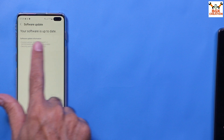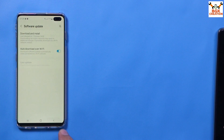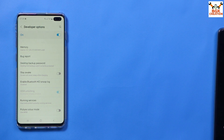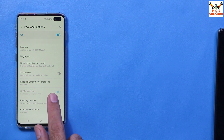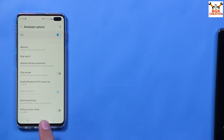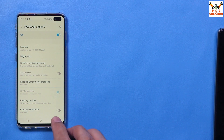My phone is already updated to the latest Android 12. Go back to Settings and open Developer Options again. This time you will see OEM unlocking is back. It may not be prominent if the bootloader is already unlocked, but you must bring OEM unlocking back so the Odin mode screen changes correctly and you can flash the recovery without trouble.